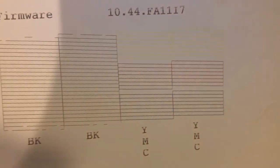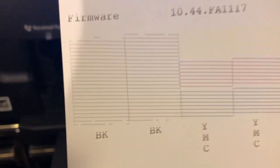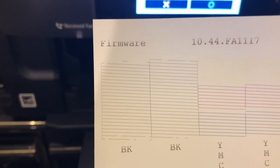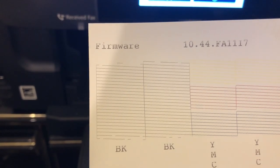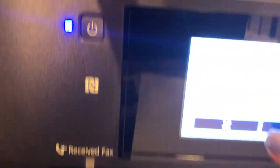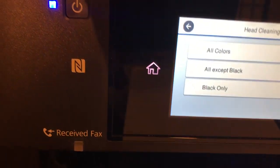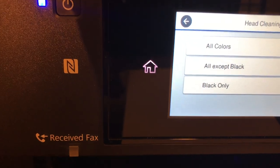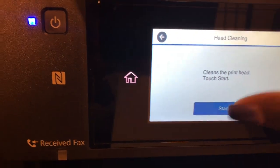It says check the print pattern to select the closest result. If it's like this one with the red lines you have to do it over again — if the lines are all straight then you're good. Let me check mine out. The lines are cut up a little bit — the yellow is good, and all the other colors are good. It's the black that's the issue. So I'm going to go ahead and run all of them again just to be sure. The reason my black is like that is because I let it run all the way out — I heard that if you let it run all the way out it takes more time to get it back into cycle. I'm going to do black only and keep running cleanings until the lines are perfect.